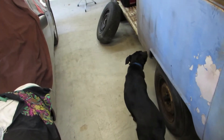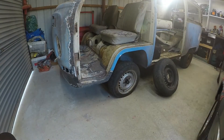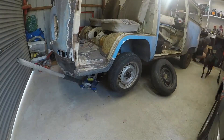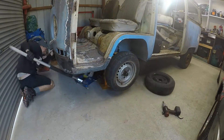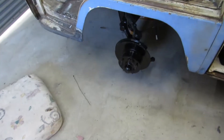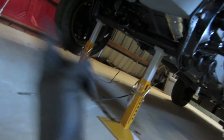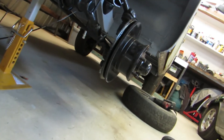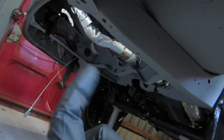Change this tyre - wheel off, got the three-piece I'm going to chuck on first. I was going to chuck the handbrake cables in but I haven't done the cables into the back drums yet. If I put them in here it would be a real pain in the ass to do up back there. So for now I'm just going to zip them up out of the way, just up in here somewhere, so they don't drag on the ground and get all dirty.